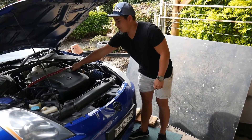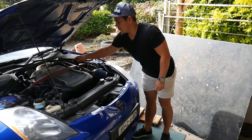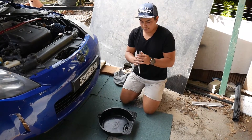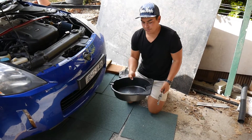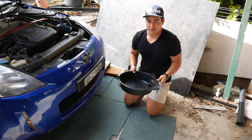Now it's best to unscrew your filler cap first. So lift it all the way to the side and you'll get it at the end. Now you need your 14mm spanner to undo the nut on your sump, and then you're going to need your oil drain pan, just because the oil is going to come out everywhere. Let's do it.